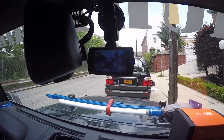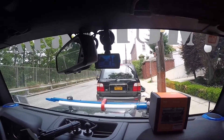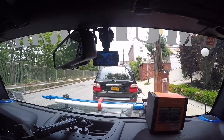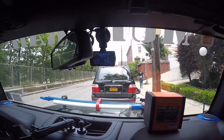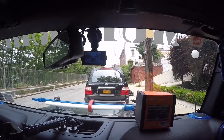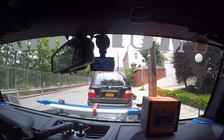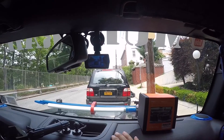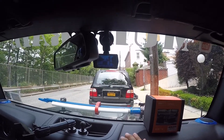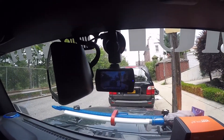It does have a parking sensor. You can get a hardwire kit if you're going to use the parking sensor, because the battery will only last about four hours while parked. The hardwire kit is about $15 — I might look into it after testing the camera for a few weeks. With the hardwire kit, if anything goes in front of your camera and senses motion while your vehicle is parked, it will turn on the camera and record.